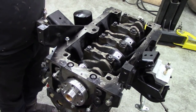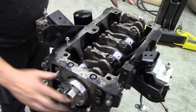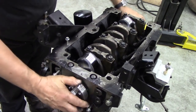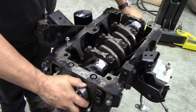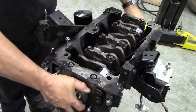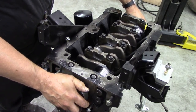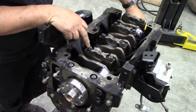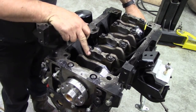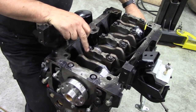I'm waiting for it to cure a little bit. Now the next stage is to torque these down. On these TDIs you can use the same bolts over again. They say to replace the nuts on the connecting rods — I don't know why, but they do.